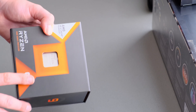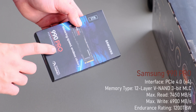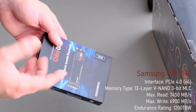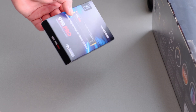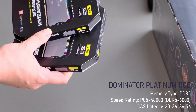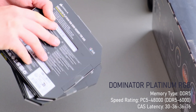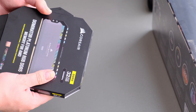I'm not upgrading to a 4000 series GPU, so every FPS I can get out of my 3080 Ti is good — driving a 4K monitor. For storage, I went with the 990 Pro from Samsung for the OS drive. These are proven to be quite robust SSDs. I got two of them at 2 terabytes each — it's only Gen 4, but with read and write speeds of about 5 gigabytes per second, who really needs more? For memory, I ended up getting two kits of 32 gigabytes DDR5 running at 6,000 megatransfers, CL30, AMD EXPO certified.